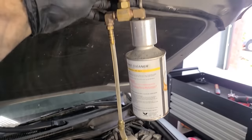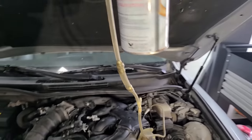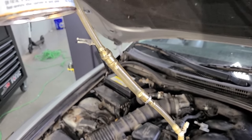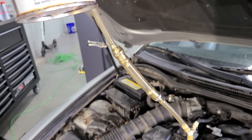And something that's very important is that you want this fully closed when you start it up, and we're gonna watch this like an IV drip. So we want like one drip per second. You don't wanna go too nuts. It's all gonna get in there. You don't wanna stream. And right now I'm slowly opening the valve and it's just gonna suck it in.